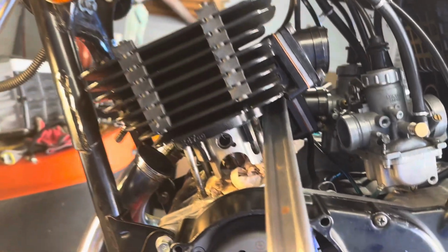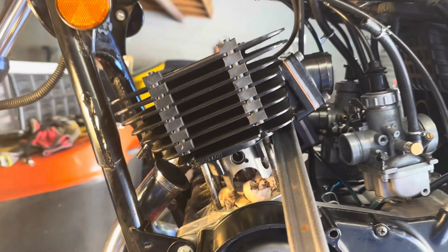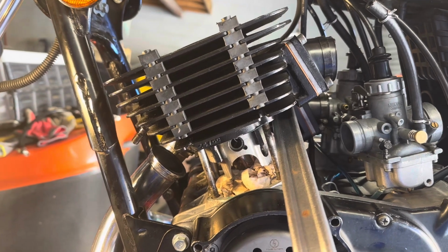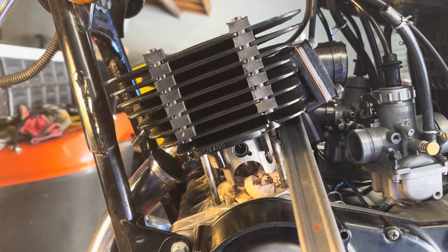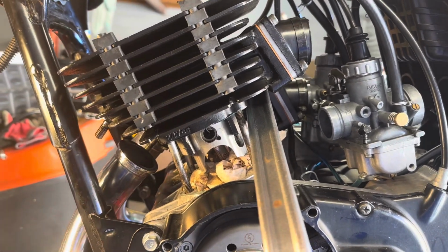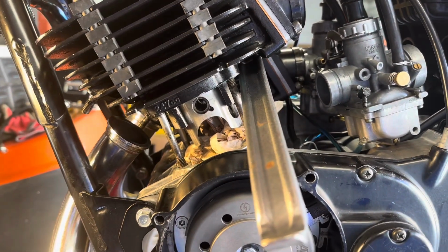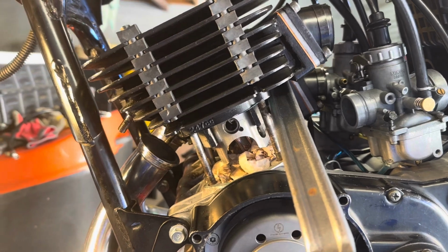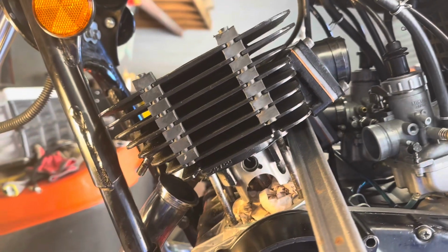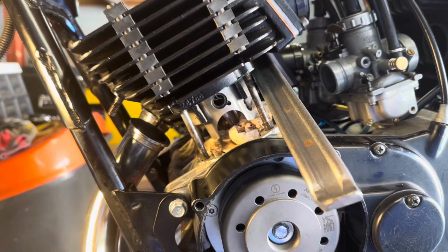That's the second cylinder on, and gudgeon pin and circlip are in. Now, you guys that do this all the time, I guess you're going to tell me it's a lot easier to work on the engine with the engine out of the bike and on the workbench, and I agree. Getting those circlips out and pins out was an absolute nightmare, and almost as difficult to get back in as well. So I think when it comes to do the proper rebuild, that engine's coming out because it's just too difficult. So I'm going to continue with reassembly and then turn the engine over just by hand,